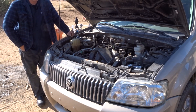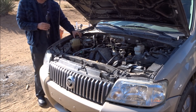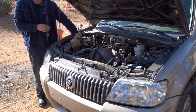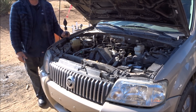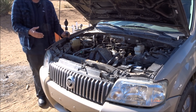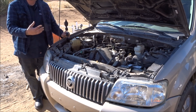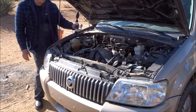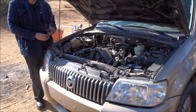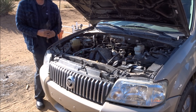It's safe to say there's nothing wrong with this car. I didn't have any issues with it before — I just ran this test to give you a rough idea of how to use this kit. It's a really good kit and it's going to be your best friend when you want to test for blown head gaskets or cylinder head gasket issues. You don't have to worry about doing a leak-down test or compression tests — just start the car, get it to operating temperature, and give it a quick test. Really fast, simple approach, and not bad for basically 90 bucks.